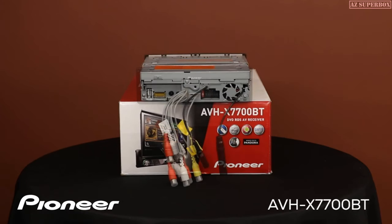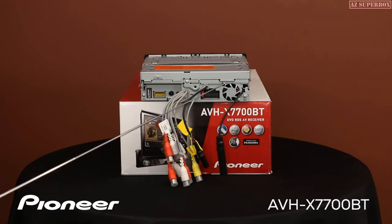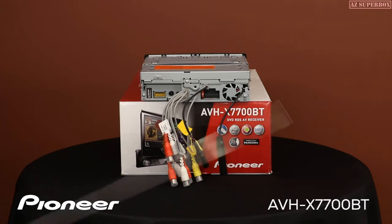The back panel of the AVHX7700BT has our USB port right here, and remember there's a USB extension included with this head unit. The yellow port right here is where we can add on Pioneer's AVIC U260 navigation system. We have two black plugs right here. The larger one is for adding on our steering wheel controls through a third-party adapter, and the second smaller one is for our Bluetooth microphone. Over here is where we would plug in the wire harness from the car.